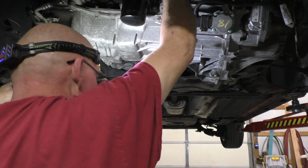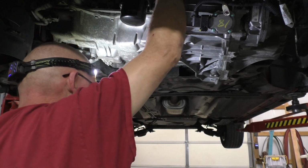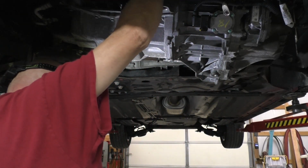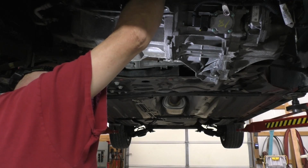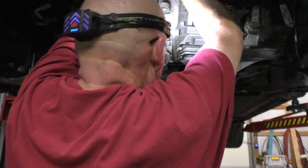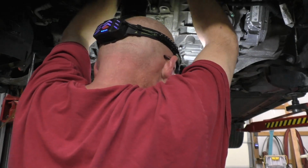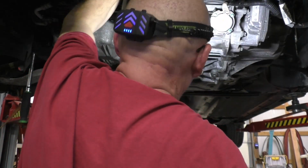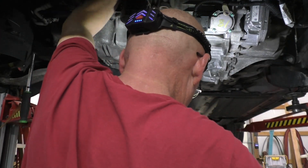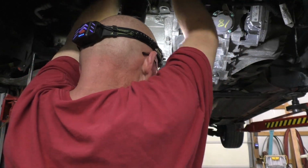Here's another stud. We don't want that one. Keep it rolling to the next stud. Here's another stud. We'll roll up on that one. That's the one we want. And if that went right, we should have another stud coming up that doesn't have a nut. If it's not right, I can still start over because I still haven't tightened them up to the first sequence. Okay? All I'm doing is just putting them on. I'm putting them on just better than hand tight.